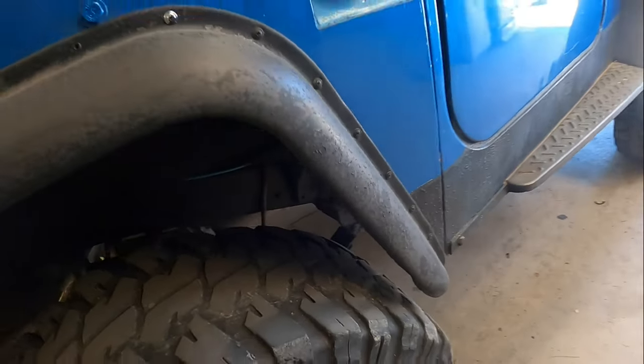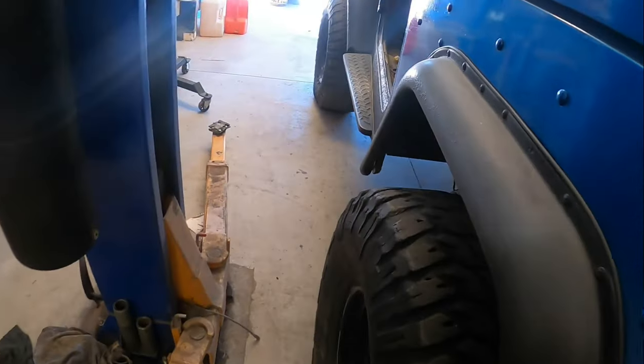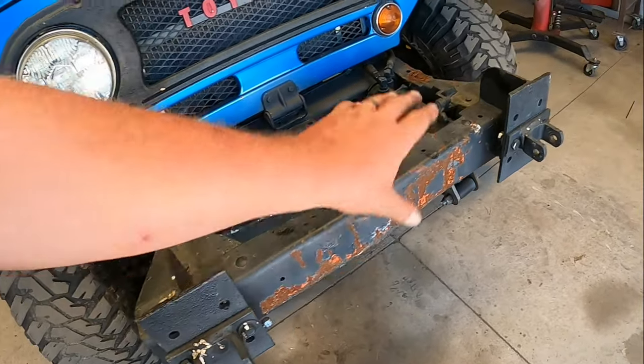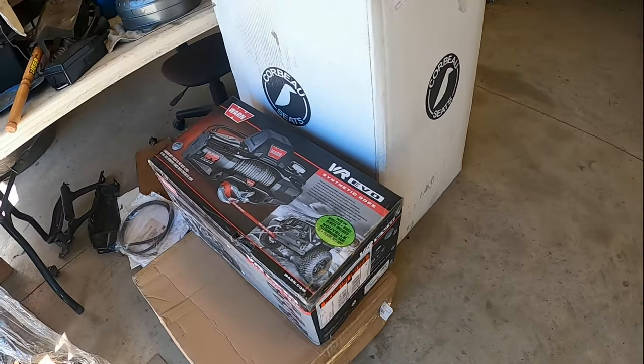First things first, I'm gonna start doing all the leaf springs and checking perches. I'm almost positive the pins in the rear leaf springs are either sheared or slid forward, because on the passenger side I can barely stick my hand in before it hits the flare, and then if you go to the other side I've got a country mile. The ass end is sitting crooked inside the Land Cruiser right now. Also gotta get on bumpers, order the parts for the spare tire swing and stuff like that. I'm gonna get the main crossbar off and start building a whole new front bumper - we've already got some cool stuff going on. Little by little - right now it's up in the air, leaf springs off, check all these springs, new bushings, and then after that I'll probably get to taking the top off.